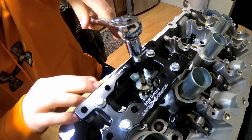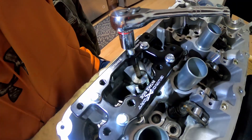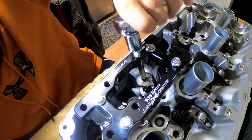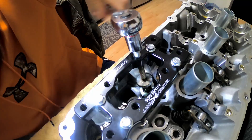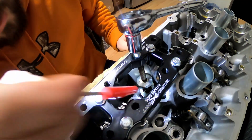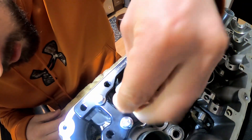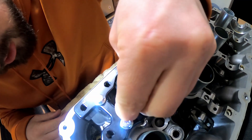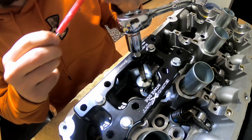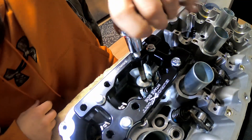It's going to go down fairly far. You can hear that — it has now broken away from the lock on top, so we're going to go down just a little farther. Then we'll use the little magnet they give us — it's a pretty strong one — and we're going to remove the locks for the valves.